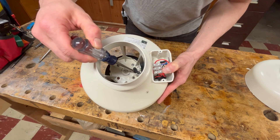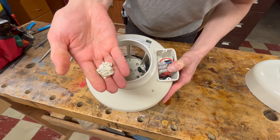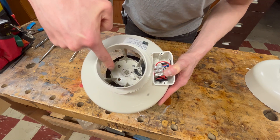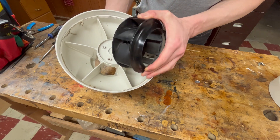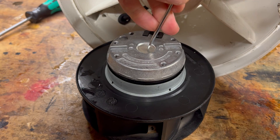Inside there was a lot of silicone right around the cord — I just peeled all of that out. Now there are four screws inside that I need to remove. Once those are out, the impeller and this plastic part can separate. You'll notice a little bearing cap on the end of the motor.